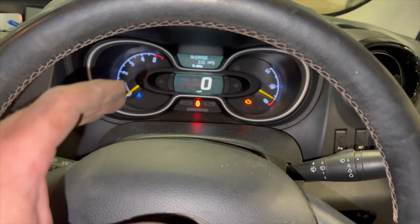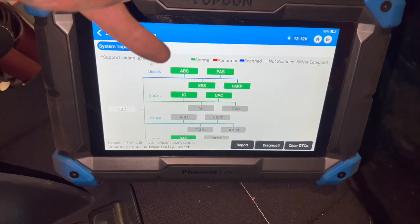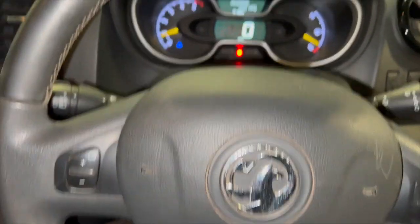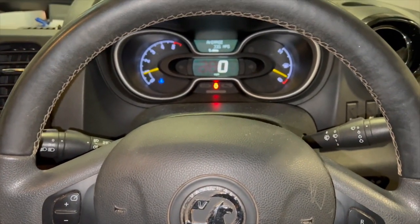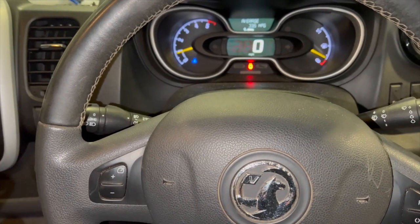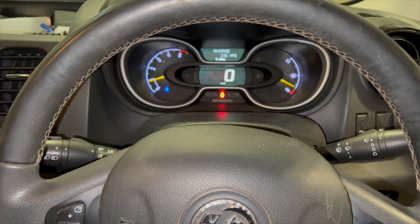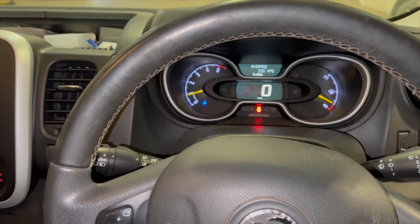Just been and took it for a run. As soon as we struck it up, the ABS light was out straight away. We cleared the fault codes before we did anything else, but before the repair, as soon as I put the ignition back on the fault came straight back in. After only two or three miles, that was enough — you can see it's all green on the ABS ECU now, we've got no faults in there. Starting it up — we're all good, no warning lights on the dash, so it's fixed the fault. I thought I'd share this because I've done quite a few ABS sensors on these and expected it to be the sensor, but it turned out to be a wiring issue. It's probably a common failure area, so if you've got an ABS fault on that side it might be worth checking there first. Hope you liked the video — give it a thumbs up, subscribe to the channel, thanks for watching.